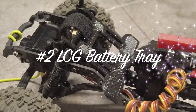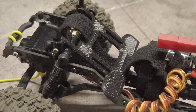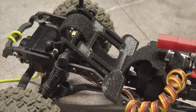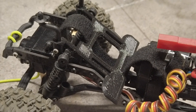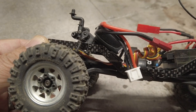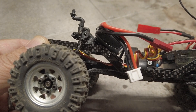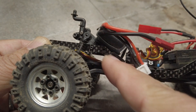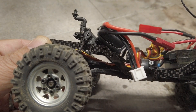Number 2: LCG Battery Tray. It's a lower battery tray remixed by NIC3509. This one works with the SCX24, Jeep JL, and C10. The nice thing about this file is that the designer added a shock mounting position, so it works with both the stock position and a bit of layback position, which I am using. Additionally, it lowers the center of gravity by lowering the front-mounted battery to sit as flush to the chassis as possible, and it is a bit lighter than the stock ESC tray that I was using as well.